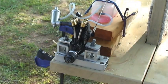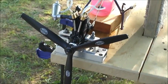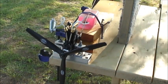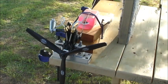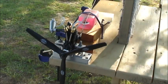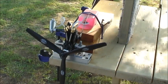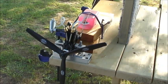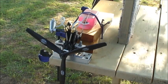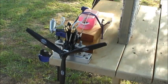This is going to be the last tank I'm going to run before it's mounted on the plane. The manual says that 40 minutes is considered a normal break-in period, but I usually don't go quite that far — I make sure I've got it all leaned out, transition is good, and about 30 minutes is what I use. One of the pros of breaking it in on a test stand is that during the initial runs it makes a mess out of everything — fuel everywhere. So if you do this before you mount it in your plane, you'll save yourself a lot of mess cleaning up the plane on the initial runs. Then I'll do some transition checks and if necessary tune the low end.